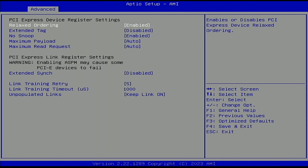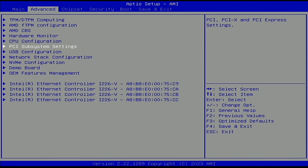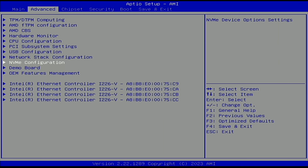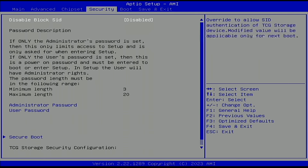Now, going through it, most of the PCIe stuff, as you might expect, is all fairly straightforward. This is a Gen 4x8 slot, but a physical times 16 slot, you're not able to take advantage of that. But what I think is interesting, and something I want to dip into later on about those M2s, have they been downgraded down to times 2 on a software level, or is that something that's locked in on the CPU level? So that's something we'll be looking into later on with UnRAID as well. But overall, the BIOS here, although it's not exactly exciting, I will say at least there is the configuration options that we'd like to see.